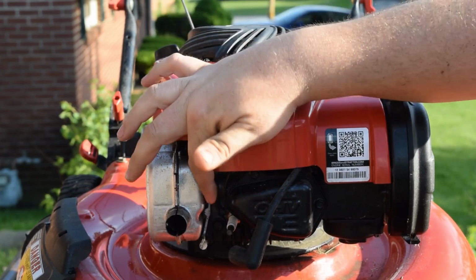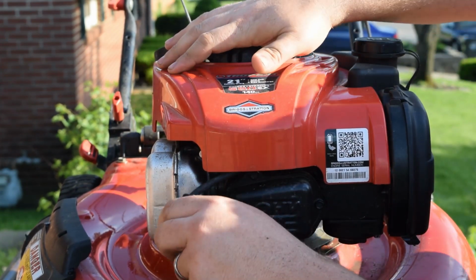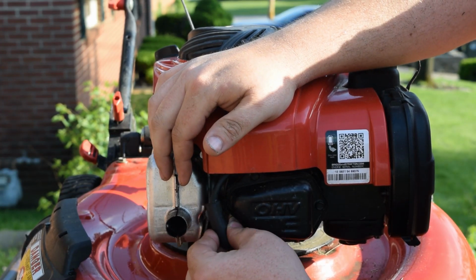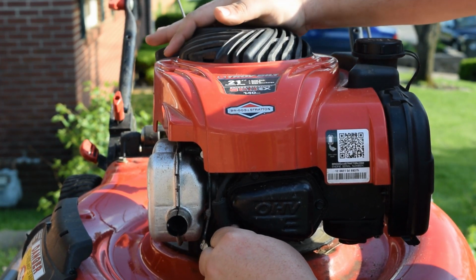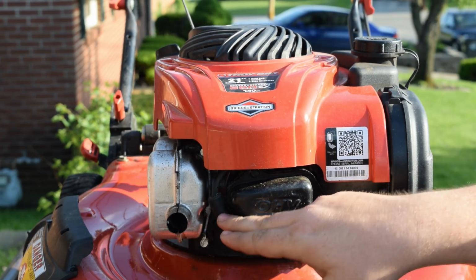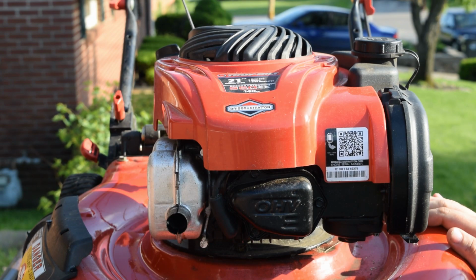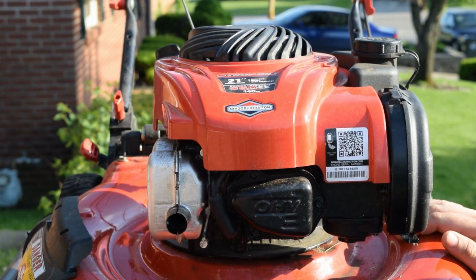So oil's been changed, new spark plug. Make sure we reinstall our spark plug boot. Listen for that click that I was talking about. There it was. So new spark plug, new boot, new air filter, and the blade has been sharpened and balanced. So with that, we're gonna wrap this video up.